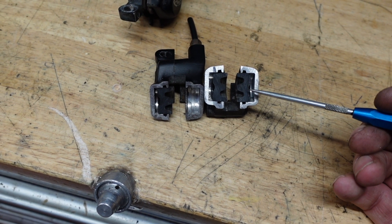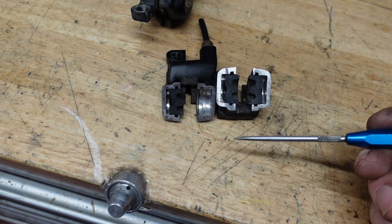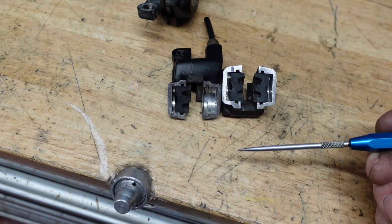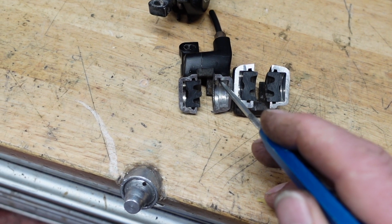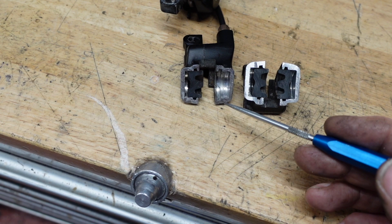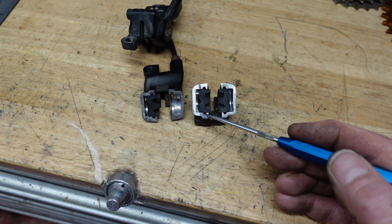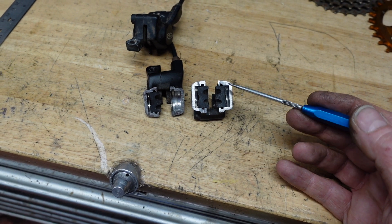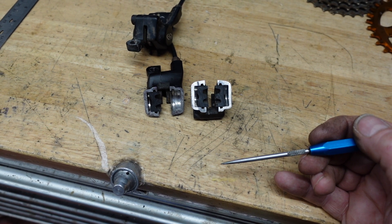That's basically what's inside a hydraulic caliper — a fairly simple mechanism, but the principle is the same on all calipers, whether four-pot or two-pot. Some are better made than others; some are cheap and nasty, but essentially they all do the same job. In this particular slot, that's where the rubber o-ring goes to stop the fluid getting past. You can see in that slot where the rubber seals go to keep all the fluid this side so it doesn't escape out onto your pads.